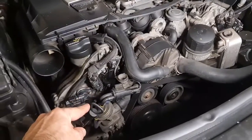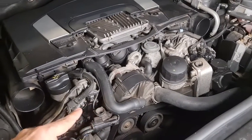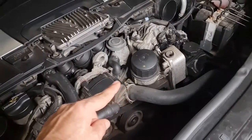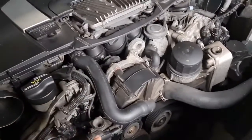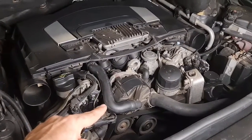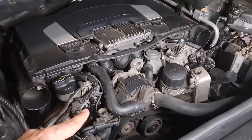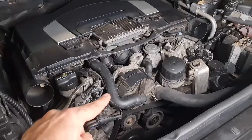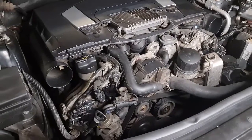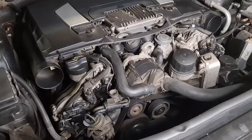We tested several items related to the secondary air pump — the pump itself, the solenoid, the vacuum lines, the hoses, the fuse, and the relay. All parts are working, all hoses are connected, we have vacuum, and the system is working properly because we are no longer getting any fault codes. Thanks so much for watching, liking, and subscribing — please have a look at my channel, I've got lots of videos coming.